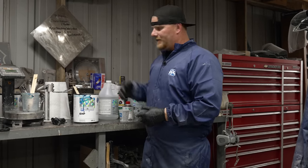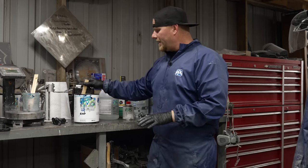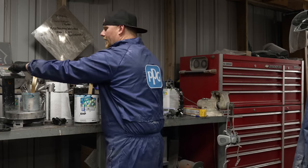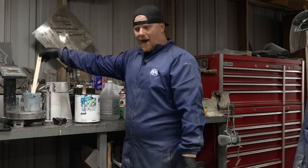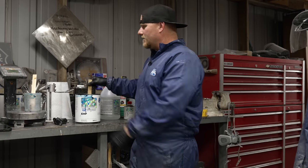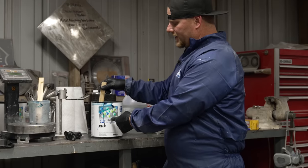We already have the viscosity. We've already reduced it yesterday. We know exactly where we need to be. I can go right into pouring this in the cup. I want to clear the paint scale so that way I can measure how this is. It does not matter if you have the paint stick in or out. All that matters is that you have zeroed it with it in there,